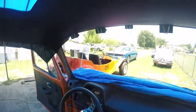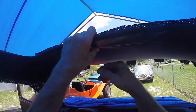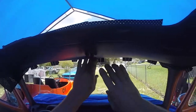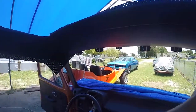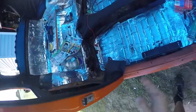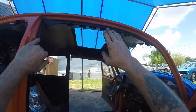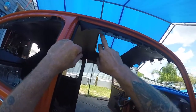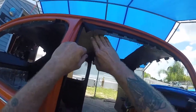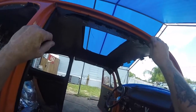I'm going to finish these sides and do this last piece because I also have to consider where the handle goes — that's going to tighten things up. Then you've got your visors going up here and their connections. Leave yourself a little bit of slack there. Also, where you have those metal teeth that bend over and tuck the headliner in — before I do that I'm going to drop the top down and run about three layers of masking tape across those teeth so the impressions don't show through the headliner, especially since this is a perforation.